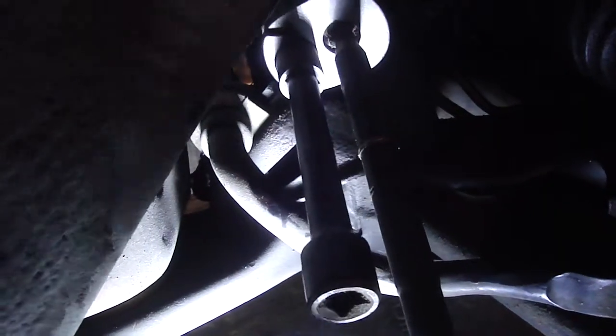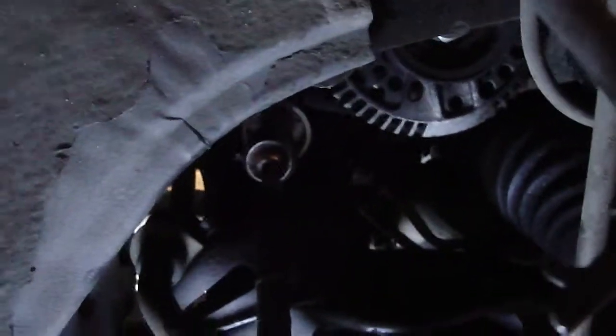Okay, let's slip the tool on. Okay, tool's on. Got my 1/2-inch drive extension in there. Put a breaker bar on it, give it over. That thing's Loctited in there. I'm hoping I not have a lot of problems. Oh heck man, I had to stand on that breaker bar in order to break this thing loose. But I think I got it.